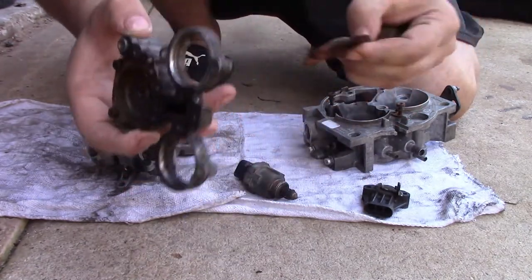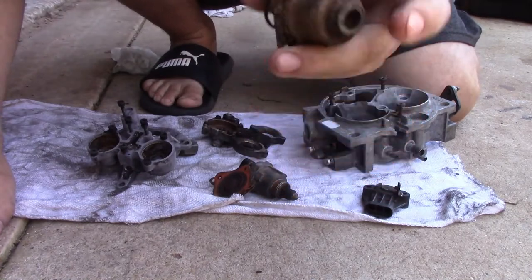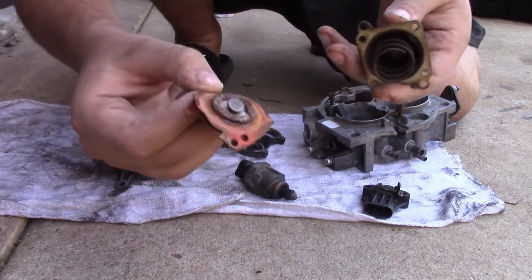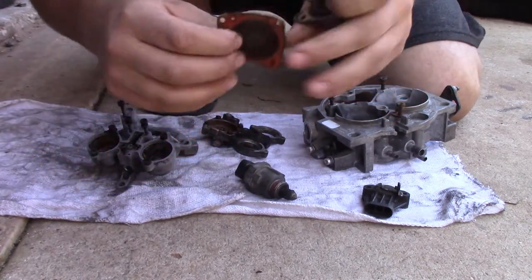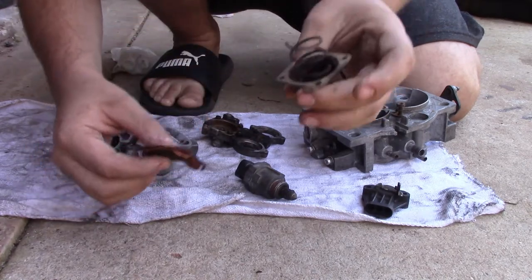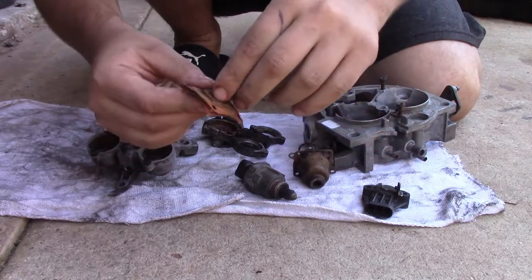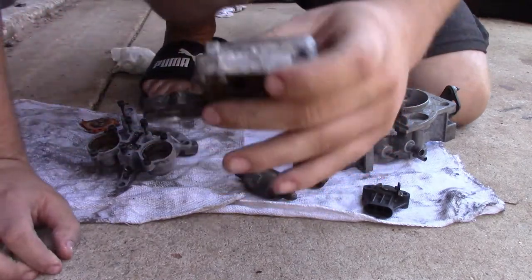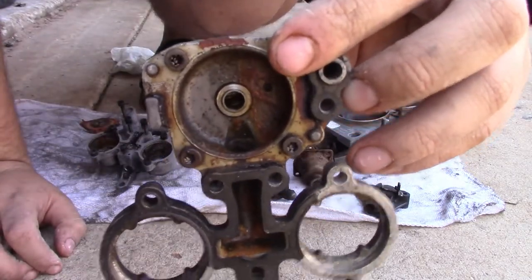This goes in here with this diaphragm, and we're not reusing this because this is your fuel pressure regulator — and this right here is actually broken. The spring is broken and rusted and this diaphragm is gone. This comes in a rebuild kit, so if you get a rebuild kit and this is savable you can reuse this bit. You can see how much rust is just inside of this thing — there is quite a lot.